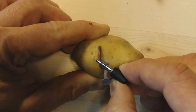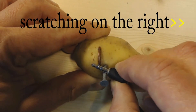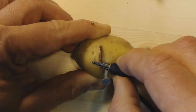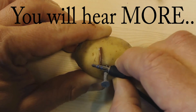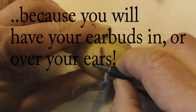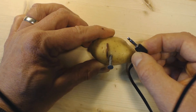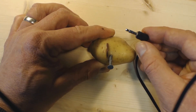That's one side — that should be the left side making noise — and this should be the right side making noise. If both the left side and right side make noise, that means there is electrical continuity within the wires of your earbud, from the connector all the way up to each earbud.